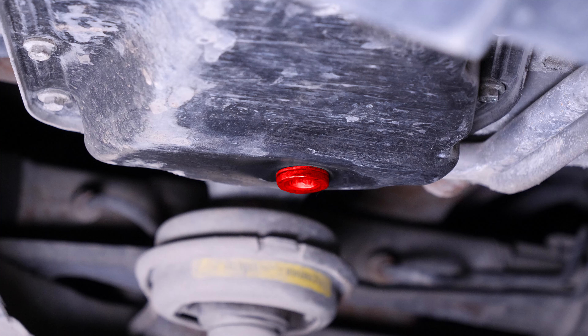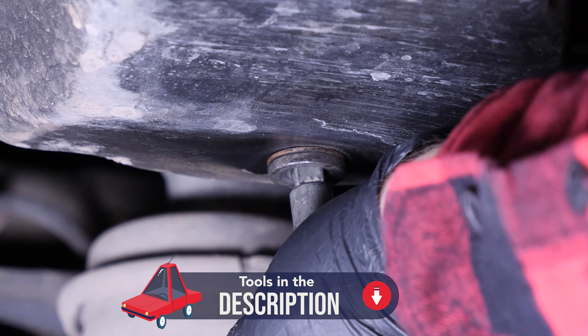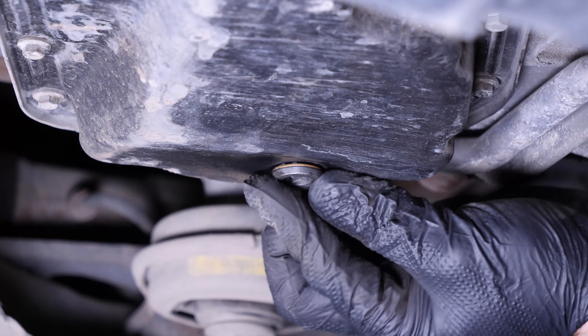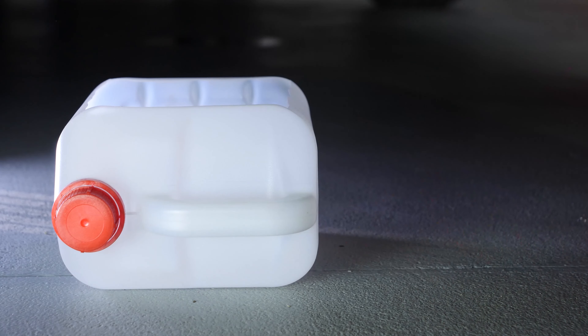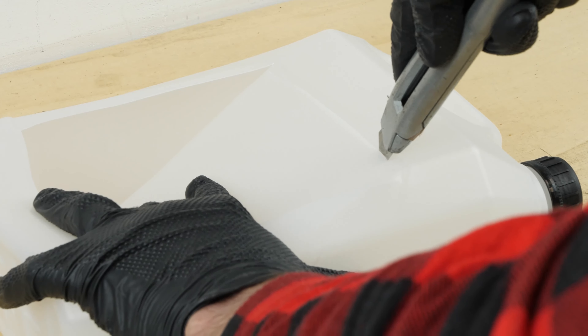You can then remove the plastic cover if present to access the drain bolt. Using a drain wrench, unlock the drain bolt and finish off the process by hand. Be careful — on the last few turns of the screw, the oil can squirt suddenly. You will have to anticipate this, making sure you have an oil recovery can at your disposal. We even suggest you craft one by watching our video: How to Make a Collector for Liquids.